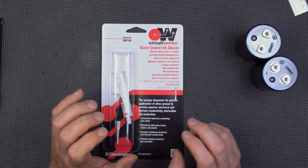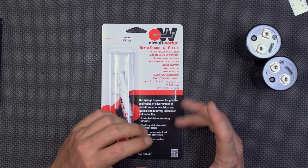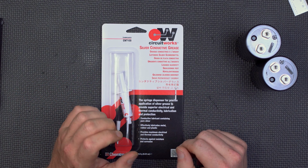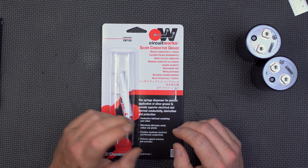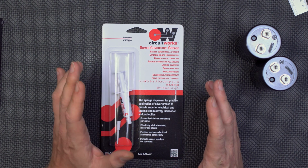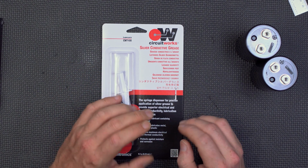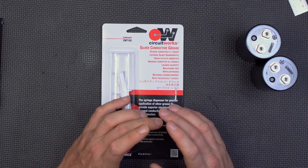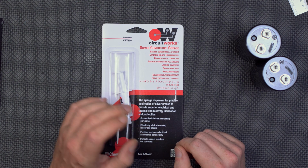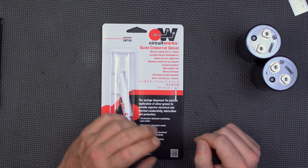So if anybody has one, anybody knows where they can get one, just leave a comment down below and I'll let you know how to get a hold of me, and hopefully we can set something up and work something out. A volute will be nice too, but realistically I think I could machine the one I have. I have a boring head for my mini mill, and we're talking about taking it out concentrically 1/10 of an inch. So it's 50 thou on a side.